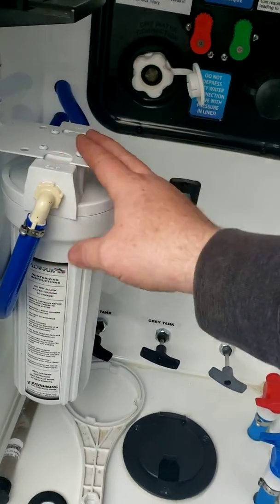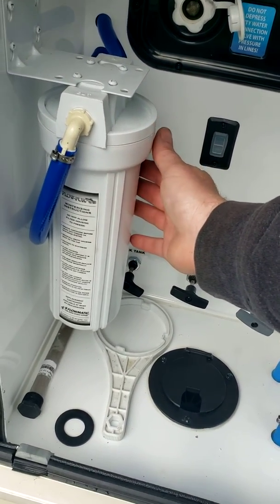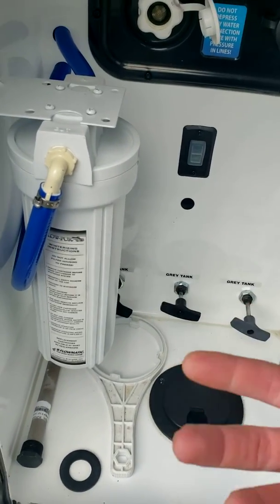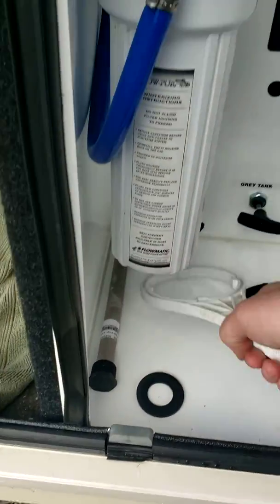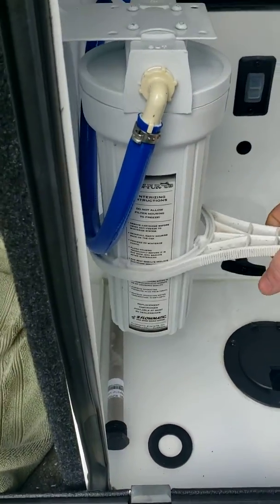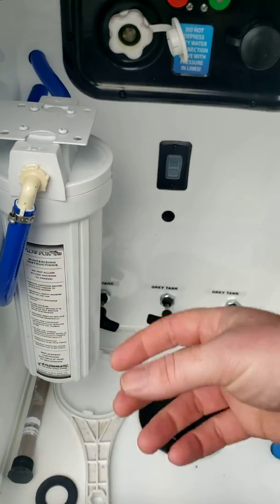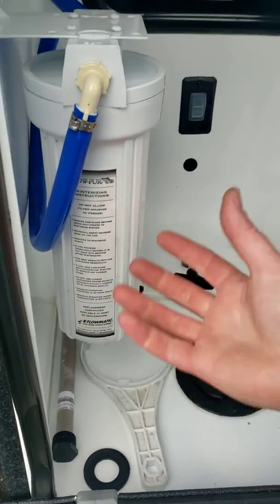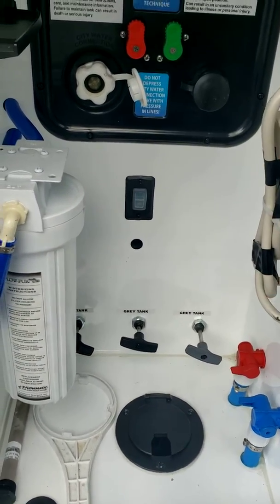And that being said, before you do that, make sure you take the water filter out, because the water filter will actually strain all the stuff out of the antifreeze that you need to protect the system. So make sure you remove that, and the tool is right here. You just slide it on, spin it off, and take the filter out, and then put it back on. What I usually do when you take it off, I fill it with antifreeze and then put it on, so then you're not waiting for a while for it to fill up and then run through the system.